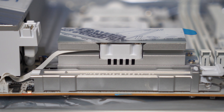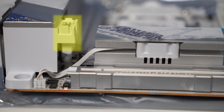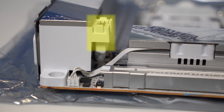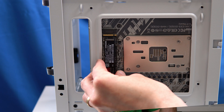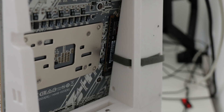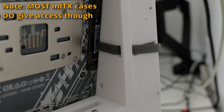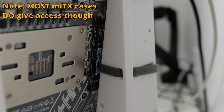Because the PCB on Mini-ITX is so small, you might have issues with the actual layout of things. For example, the front panel audio header on this is actually raised up like some weird half-breed header. This particular motherboard also has a second M.2 NVMe slot on the back of the motherboard, and a case I recently built in actually blocked off that second M.2 slot. So if I ever wanted to change that M.2 drive, I'd have to take out my motherboard from the standoffs — which is a little bit annoying.